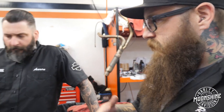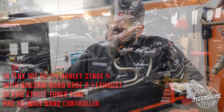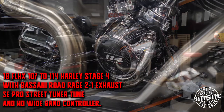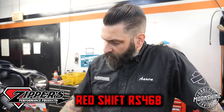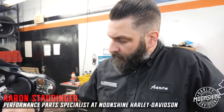What's the game plan? What's he starting with, what's he going after? This customer's got a Harley Stage 4 kit, and he wasn't really pleased with the performance it was giving him, so he called us up, found us on the internet, and we're switching him over to a Redshift 468 cam. We're leaving the majority of the motor the way it is — we're going to do an S&S plate and pump setup, and just kind of freshen up the bottom end and make this bike produce what it should.